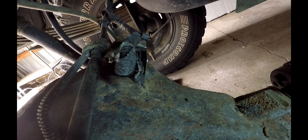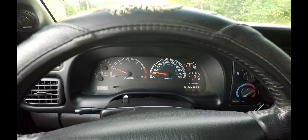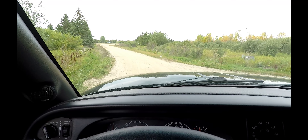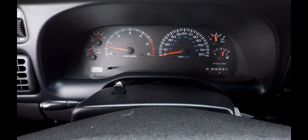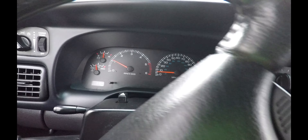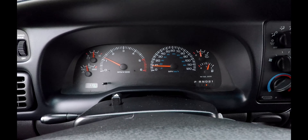Got it all hooked up. I'm going to start it up and see if everything works. Here's the test — haven't even started up yet, put the new sensor in. Let's see if the ABS and brake lights come on. They're all out — perfect, perfect, perfect! As you can see, my speedometer works, there are no brake lights or anything else on. I'm going to slow down right to a crawl — okay, now I'm stopped, and now I'm going again. Speedometer comes right on up to 10, nice and easy.